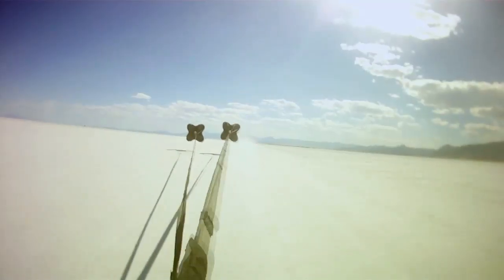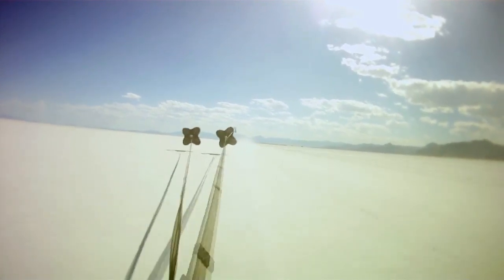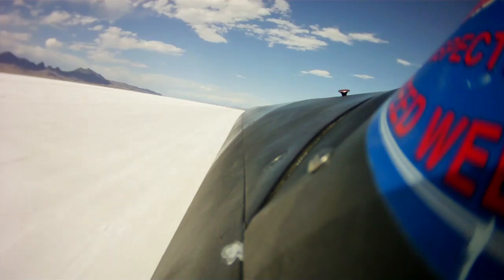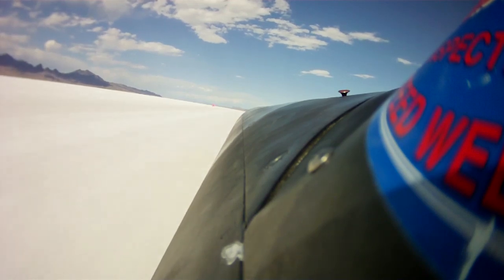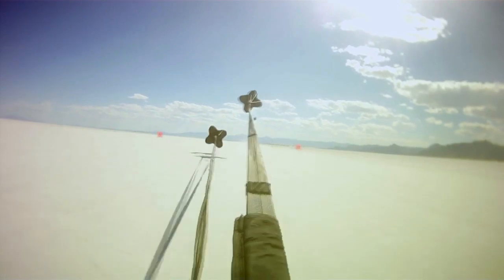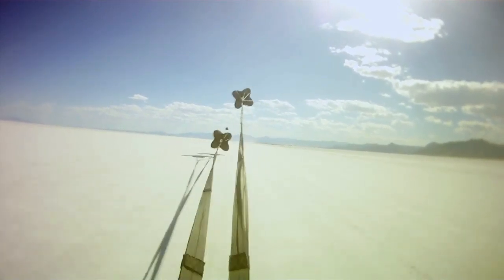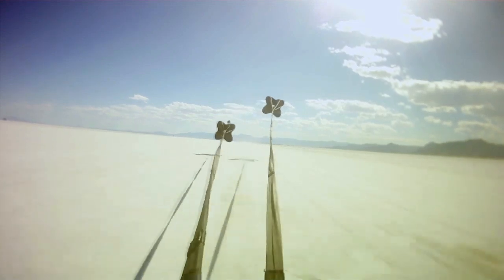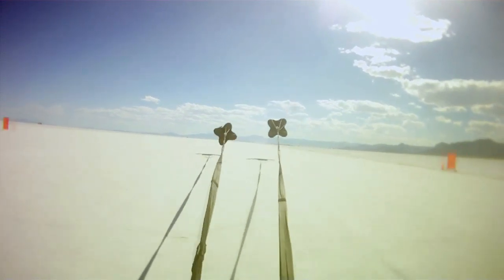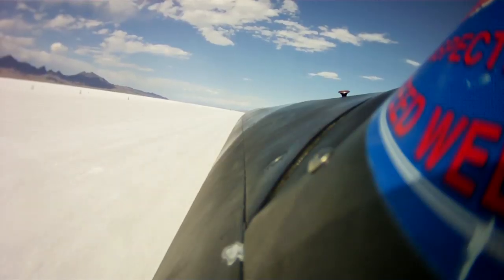It's quite a big hit — your eyeballs feel like they bounce off the windscreen, but it's not a bad hit. Then I start easing off the gas, and I'm still in gear. I hit the second chute, and when the second chute hits and the car stabilizes, I come completely off the gas, hit the fuel and knock that out, then take the air shifter and disconnect that. At that point I'm coasting, my right foot covers the brake, and we try to keep the car going as straight as possible.